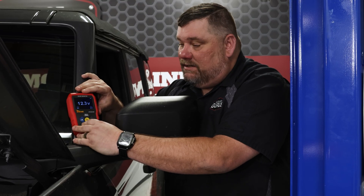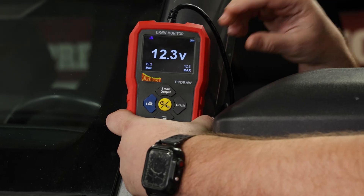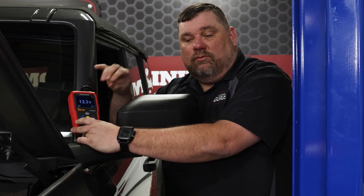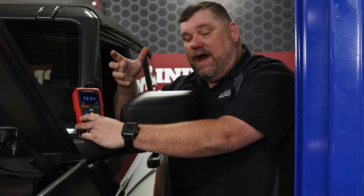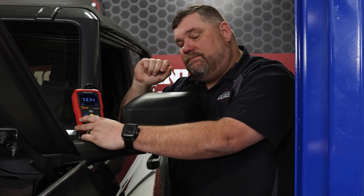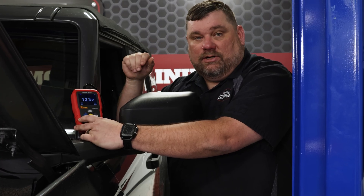The next one is this blue link button over here. We're going to turn that on — you can see a little Bluetooth indicator up there at the top. There's a Power Probe Link app you can download, and instead of having to stand around the car and watch this thing, once we get it going I can actually have it on my phone. I can look at the voltage reading, and once we have smart output turned on, we'll be able to see the current draw as well.